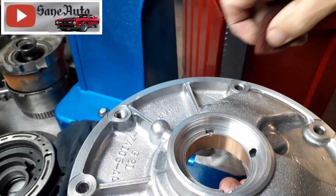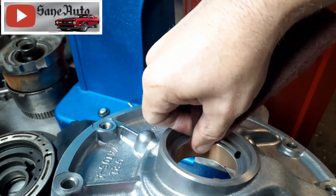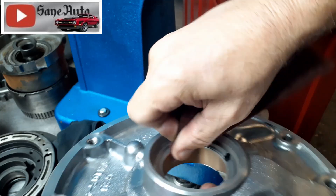What I do is take a pocket knife and scratch right there toward the stake, to make sure we don't have anything sticking up that could scratch a spot on the converter hub. Then just to be sure, take the scotch brite and do that little spot as well. Feel it — nice and smooth.